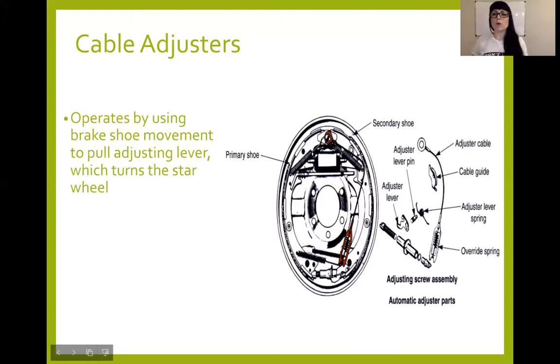Different designs call for different component usage. Anytime you are working on a set of drum brakes, it's always a good idea to check out your service information, or at least take lots and lots of pictures so you know how to reassemble them. Most of the time that is going to be half the battle. Back in the day when I started as a technician, cell phones were really bad and taking pictures wasn't always an option — not everybody had camera phones. Now we have camera phones that take better pictures than professional-grade DSLRs. Take pictures of everything before you take it apart. The worst that's gonna happen is you won't need them and can delete the picture; at best you'll be glad you have them. Always take pictures, especially with drum brakes.